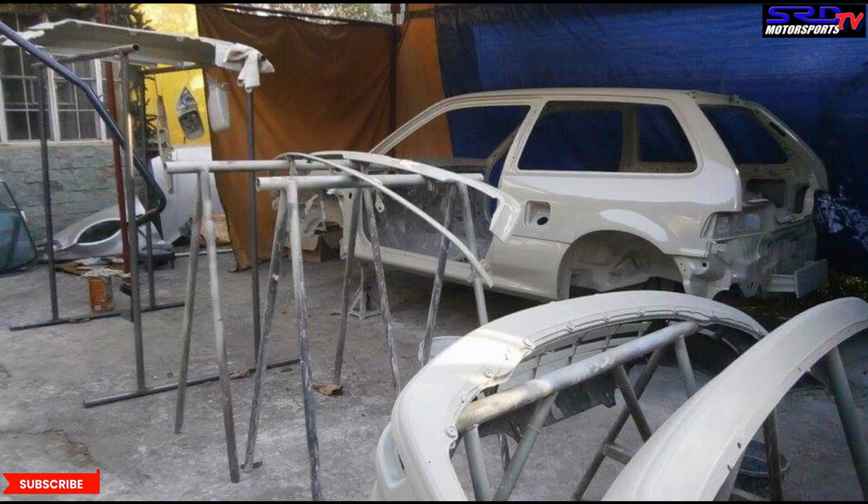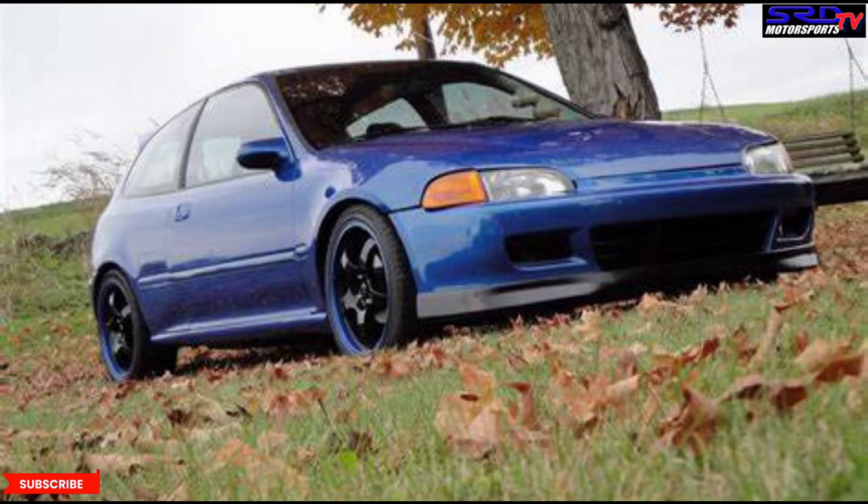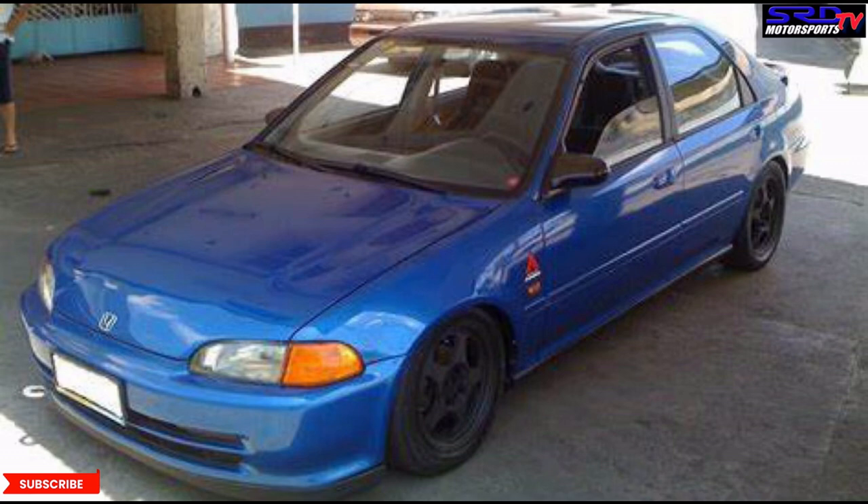It just gives a sense of wave on the depth of the shine or on the paint job. Here's a picture that shows what I'm talking about. On a shiny repaint job, look at the hood — even the fender — the reflection is not that crisp. It's kind of blurry. That's what Bong calls alon — it may be shiny, but it's not smooth. Here's another example: look at the gap between the door and the body — that reflection is not aligned, it's kind of off. That happens when the base is not good. And look at the reflection of the roof — the shade is supposed to be straight, but it's not. That's why Bong calls it alon, and this starts from the beginning of the primer. So you gotta prep it really, really well.